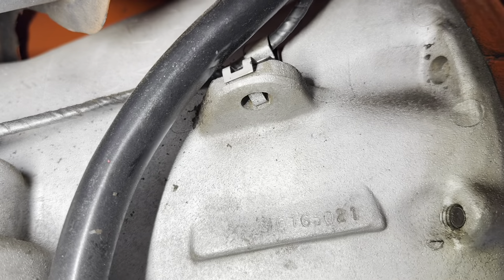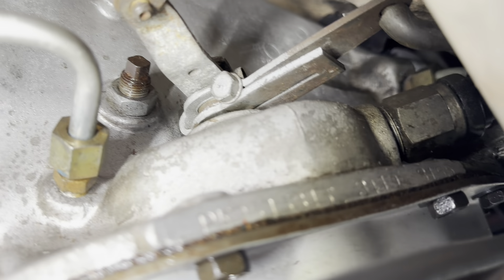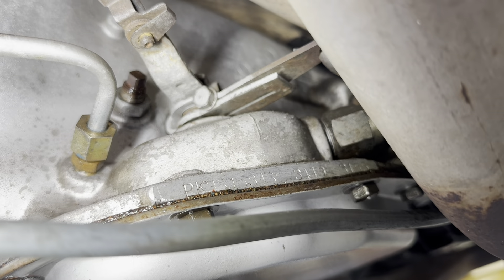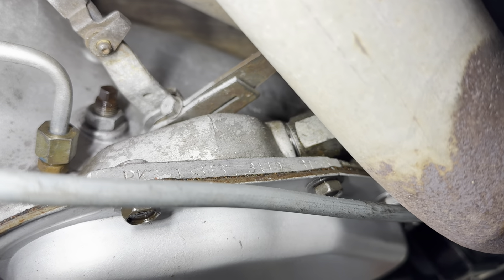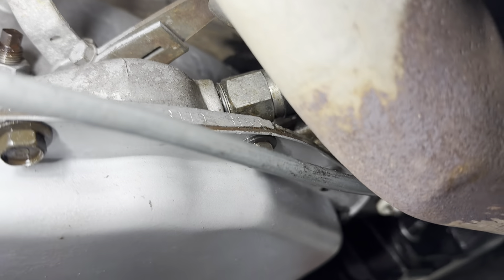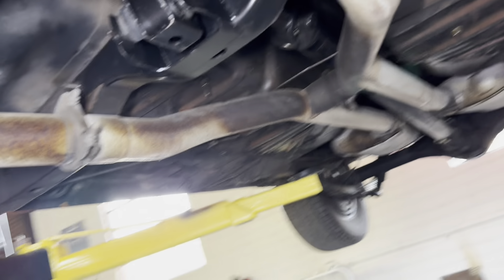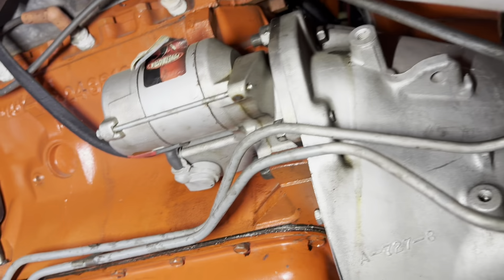Make sure it's the right font and everything looks good on the VIN stamp. There's the trans VIN - it matches. On the trans you go to this side of the pan: the part number is 351-5846, which is the right number for it, with the 10 calendar date - all matches. Everything looks really good on that, so it's numbers matching. It's got exhaust on it that's been on there a while, and it's got a mini starter.